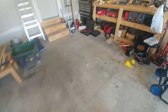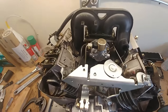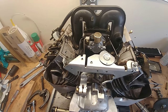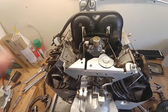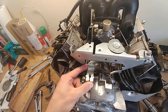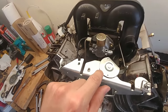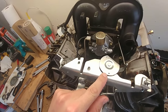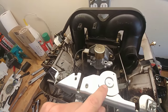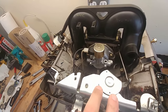I've seen and had a lot of questions about what all of this stuff is on this linkage — the throttle, governor, what controls you're making, and how to adjust them. First, this piece right here is your governor arm; this controls the governor inside the engine, which is a flyweight mechanism. Your throttle cable attaches right here at this throttle wheel. This has been a point of confusion because it doesn't actually attach to your carburetor up here — what you're really doing is controlling your governor, which in turn controls your throttle.